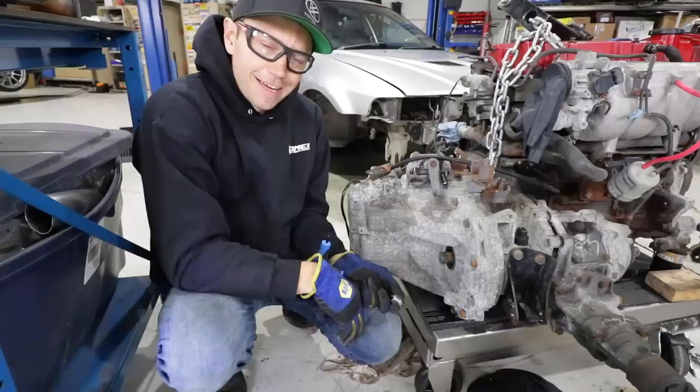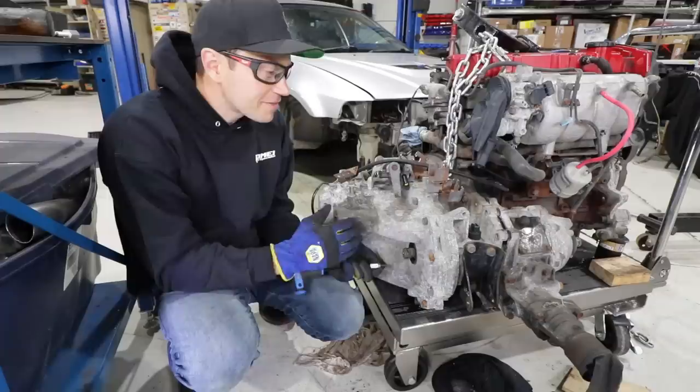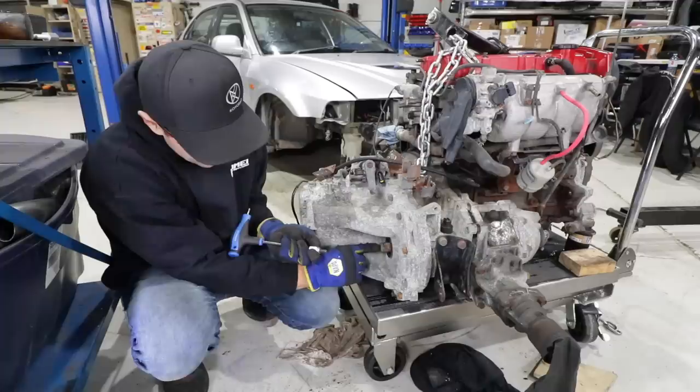After about 20 minutes of fighting with this thing — well, it just felt like 20 minutes, to me it felt like an hour — too much time has been wasted getting the transfer case off, and that's because we've never done this before and we don't have instructions. What I just noticed is when we're shaking or moving it out, this side of the input shaft is also moving in, so I suspect we have to take it off.